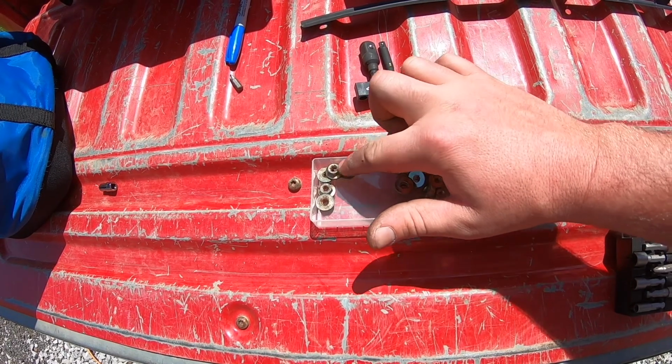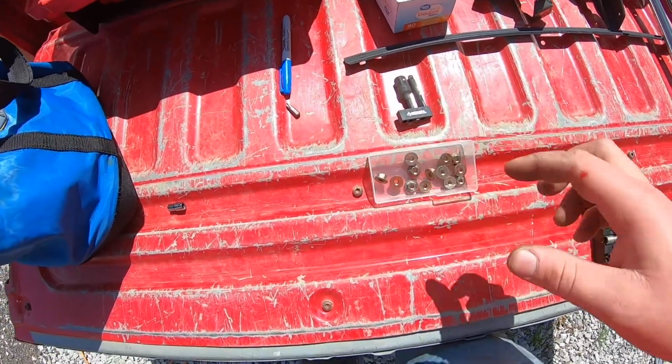There's ones over here in the corner too that you'll need a ratchet to get to. Your impact driver won't fit in there. So here's a little quarter inch ratchet. Yeah, 13 of those. They're all 10 millimeter. So next we've got to pull these metal rails out like that. There's the passenger side one out, the main back one out. And here's the driver's side. Next we'll pull this rain rail out.